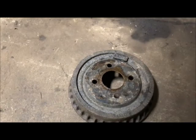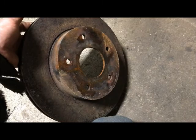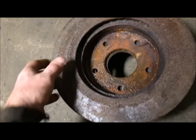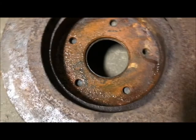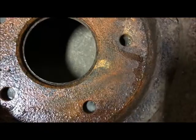So what I'm going to do is, I was playing around, and here is the Ford drum, the four lug on this is a four lug by 4.5 bolt circle. This is a bare rotor that was from the second gen rear, and somehow it works out that the register on the drum and the register on that rotor just lock together. I mean, it self-centers. It's unreal. And if I line up one bolt hole, all the others are solid.